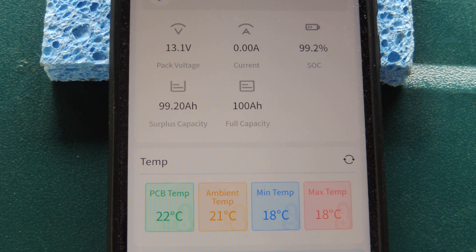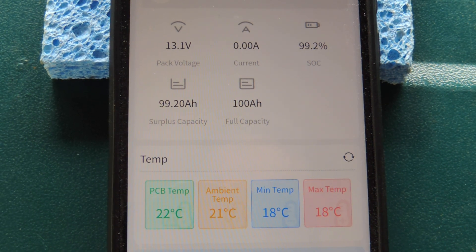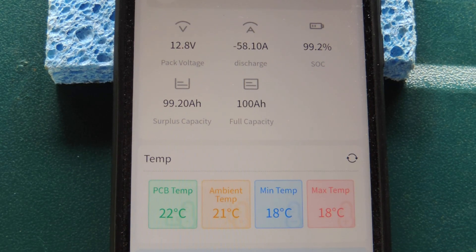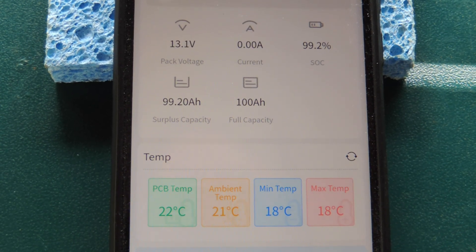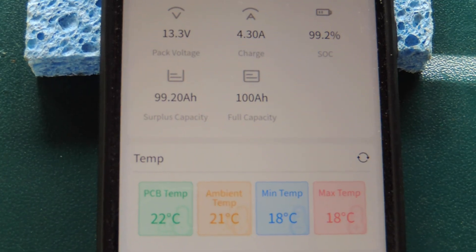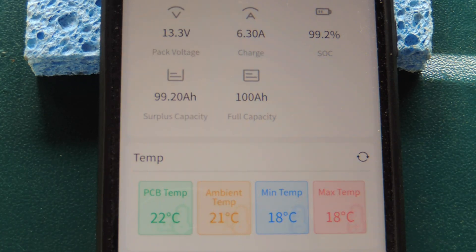We're at 99.2%, still got 13 volts. Generator still won't start — there we go. It drew 58 amps. Not charging. My generator does not charge the battery. So right now the only way I have of charging this battery is the original converter that came with the camper. We're going to be doing some upgrades at some point, because that is unacceptable.